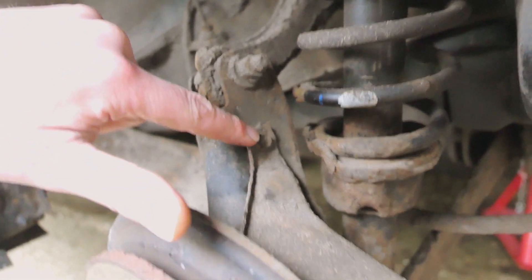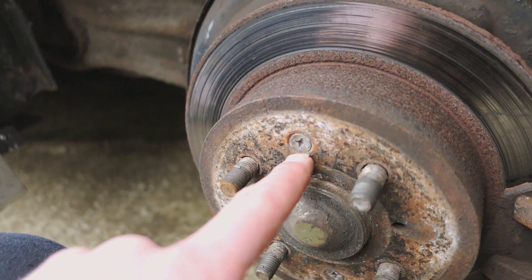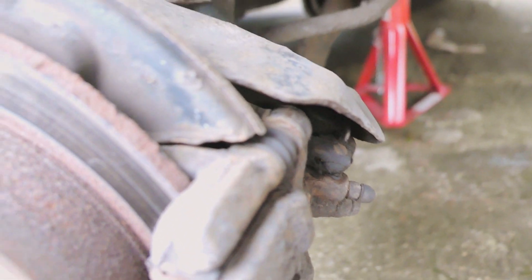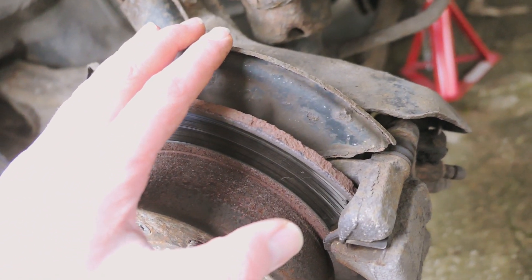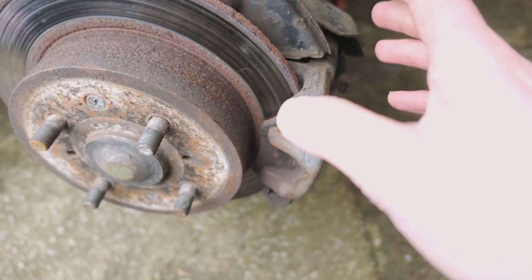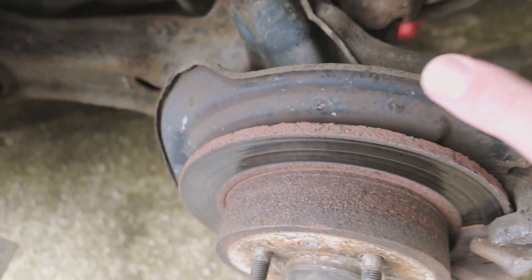With the wheel off, use a 10mm on a couple of bolts to get the brake caliper shield off. Then get the caliper slide bolts out, and hammer off the locating screws for the rear disc which centralise the disc. Once the slide bolts are out and the caliper is removed so we can get the disc and pads out, we're going to get the rear caliper fully removed from the handbrake cable, clamp the brake flexi, and unbolt the brake line from the caliper. Then swap it over, then get two people on the job to bleed the new brake caliper. That's the plan - first thing, caliper shield off.